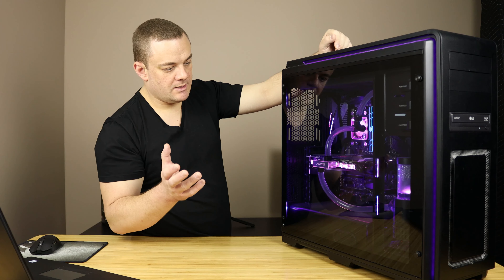The surface of the block, even with the thermal paste on, still looks pretty good. To remove the fittings, if you can't do it by hand, a 5/16th allen key will fit into at least the EK fittings — apply a little bit of pressure to start them and then take the rest out by hand. I've cleaned off the block with some isopropyl alcohol to get the thermal paste off. Take a quick look at the fittings and make sure the O-ring isn't cracked, there's no dirt, and it's not dried out. Those ones look good.